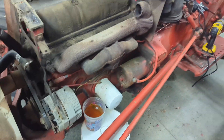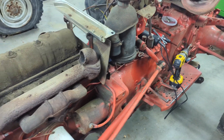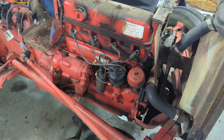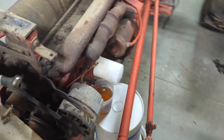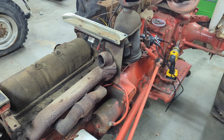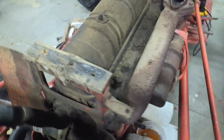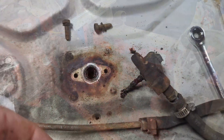Next, we'll probably take a look at the wiring. I do have a wiring harness that should work on this that I bought for the 641 — it should be pretty much the same. Just being 12-volt or 6-volt, I'll have to check that out, but I think the wires to the alternator versus the generator is really the only difference between the wiring harnesses. We'll probably take that air cleaner off too and get the mesh out of that and soak it as well. Then we'll look at getting the engine to turn over and see what we've got.